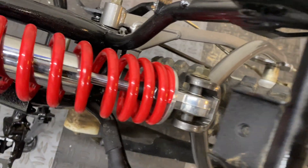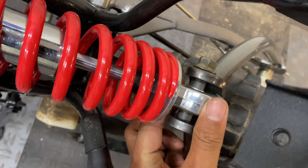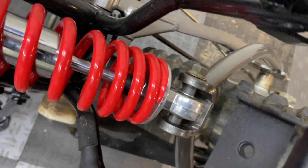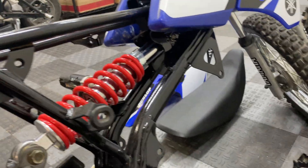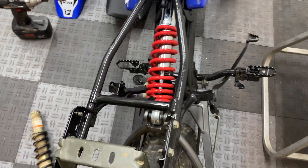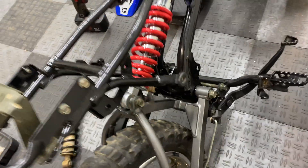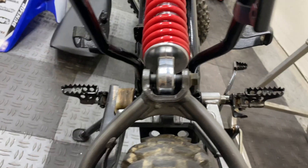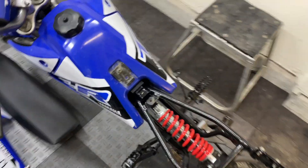Here's how the rear shock looks installed. I had to make some 10mm spacers to get it to fit nice and snug since the factory shock has a much wider collar than the aftermarket one. This is a universal 110 pit bike shock by TD Pro — it is hydraulic and fully functional. I still need to get a longer rear bolt to fully install it since the old one had to get cut off, but we'll see how it rides when the bike's fully put back together.